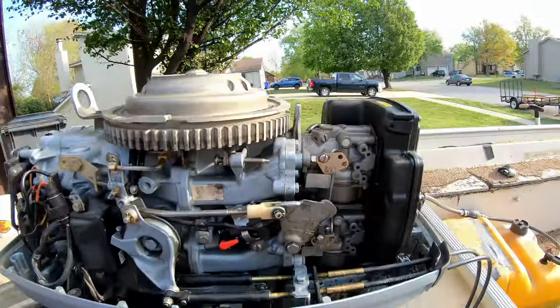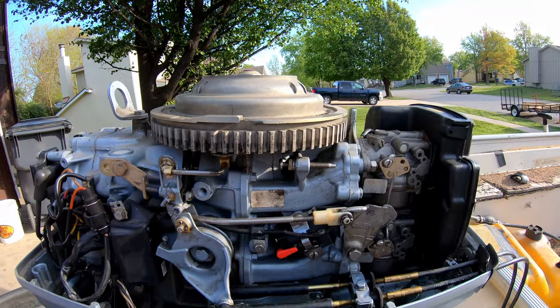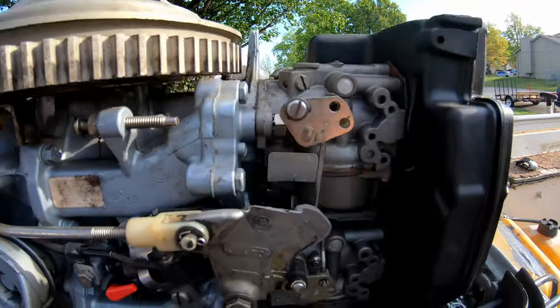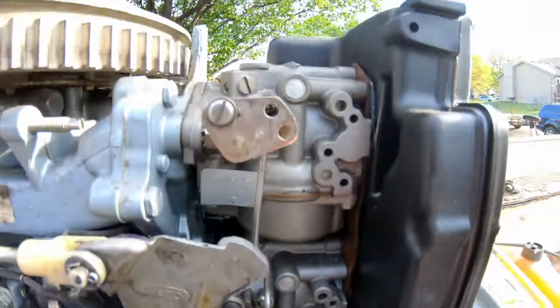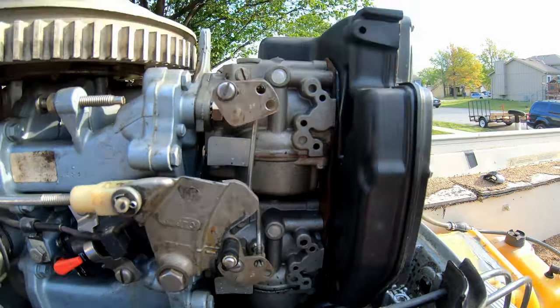Using a tank has had a huge effect. I've used muffs before and thought I had a beautiful idle on several different motors, but you put it in water and it's just different — the suction is different, the accumulation of water coming in is different. This motor was running but it would idle real crazy, shake back and forth, and then just die. At first I always think carbs, and this one's got two carbs.